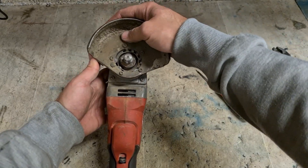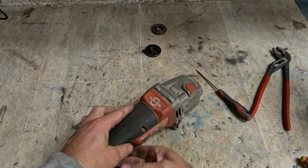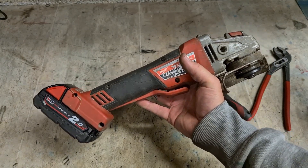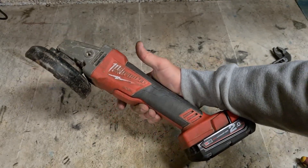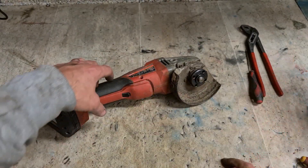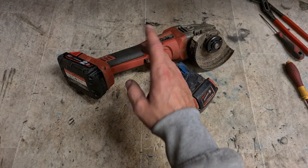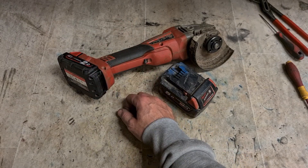Actually a decent little grinder — it would probably be the best brushless cordless grinder on the market if it wasn't for that bearing. If they would just fit a high quality NSK bearing, that would probably be the best four-and-a-half inch grinder on the market. But for 25 euro it's not hard to fix up. Sounds like new. That's how you fix the Milwaukee grinder with the notorious bad bearing. One Milwaukee grinder fixed up, one battery not worth fixing. Thanks for watching lads — if you like the video give us a like, and if you like tool repairs, tips and tricks, give us a follow. Cheers.